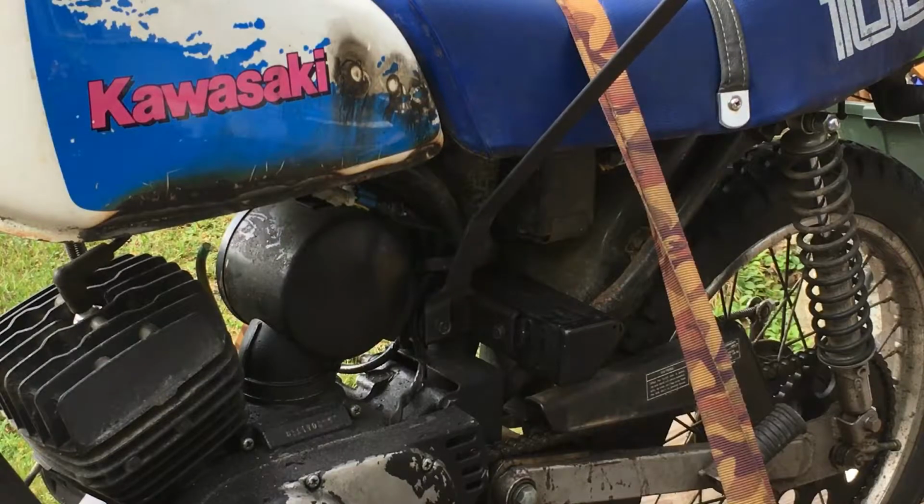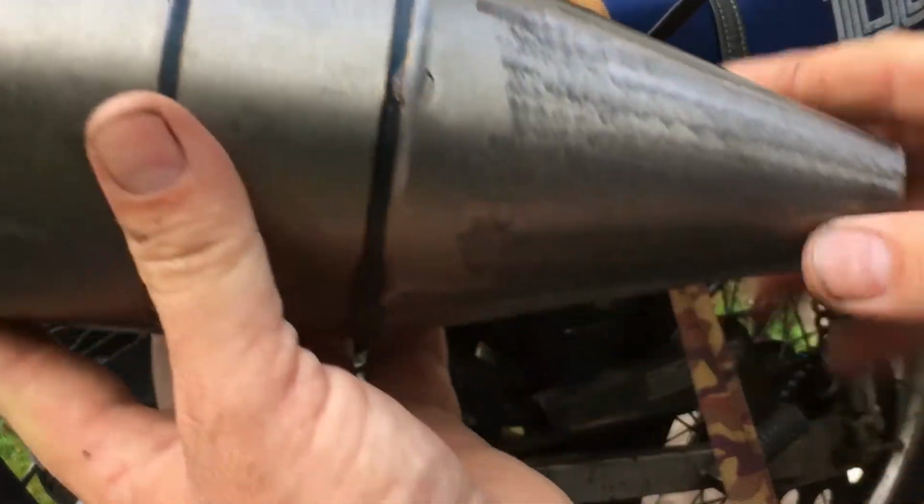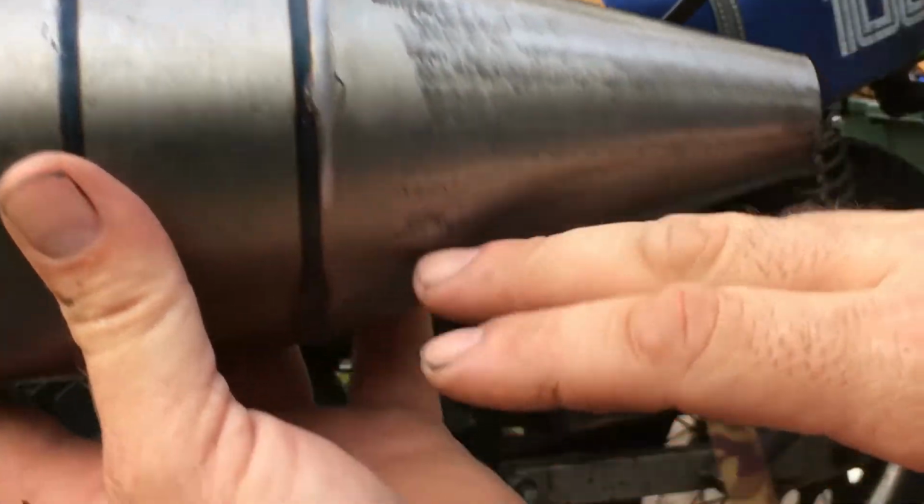There is no fuel, and that fuel tank has been flushed out completely. So I just wanted to let you guys know that. This bracket right here I put on here. It's on there, but it's snug so we can maneuver it, because when we go to weld it and check out where it's going to go, this is tapered. So you might have to move it at the angle to mate it up properly to figure out where you're going to cut it.